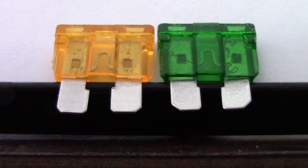So let's take a closer look. Here are two fuses side by side — a 5-amp on the left and a 30-amp on the right. Notice the size of the element. Looking at these fuses and all the sizes, they're equal in size. I have no idea what amperages will burn out, but unless the fusible links are composed of different alloys — and that's not likely at 12.25 cents each — they'll all burn out at a relatively equal amperage, probably somewhere around 10 or 15 amps.